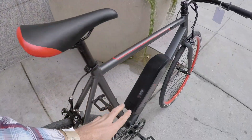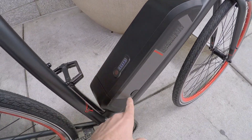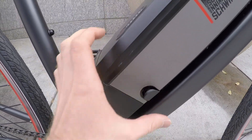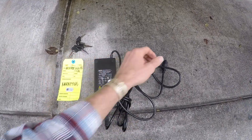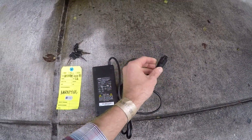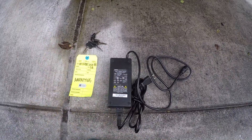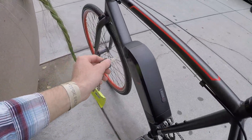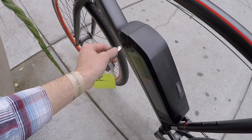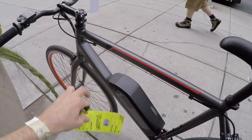It's nice that they kept the battery pack at a higher capacity — it weighs about 5.6 pounds. I took it off the bike earlier. It's got a little LED power level indicator built right in and a charging port. The plug is not my favorite — it's just a little plasticky thing. The charger is 2 amps, which is about average — not super fast, but the battery capacity is average anyway. The charger weighs 1.3 pounds, so fairly portable. You insert the key and the battery slides out to the side, which is a nice design feature.